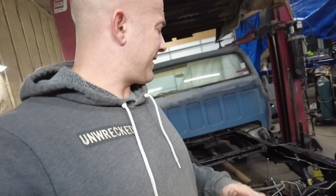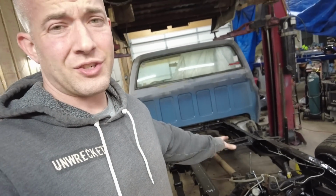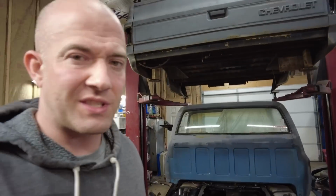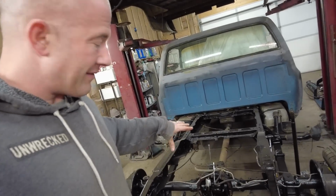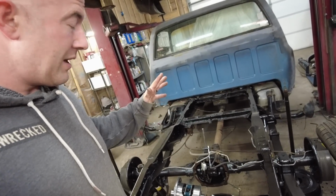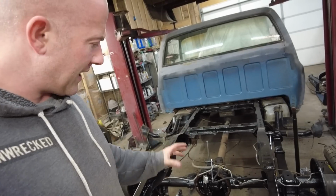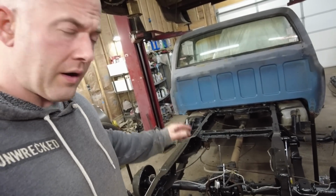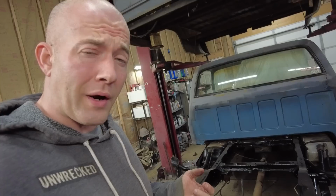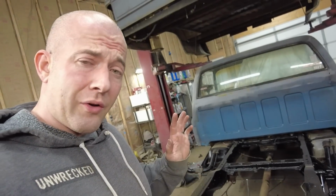Mind the wobbly dial indicator. The magnets are going short in that thing. Me and my dad tried to mess with it, but it just needs new magnets in it. So I ended up having to set the base on top of my axle and then just kind of holding it there. Getting about 12 thousandths of play there in the ring gear. And that's where we want to stay, because that's how this thing's been running. It's running fine. So that's what we want to do.